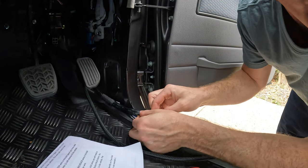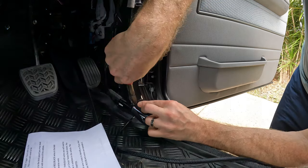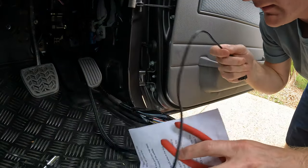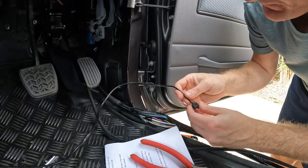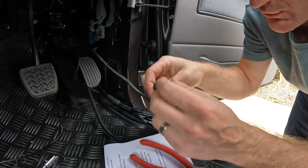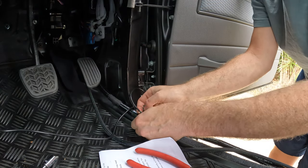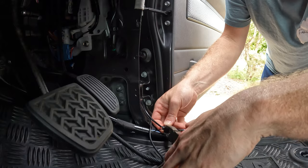You can get a current meter but I unfortunately don't have one - you just put it around the wire. I'm just cutting this so I can feed the wire back inside the cable and have it all look nice and neat. Pretty much how these splice connectors work: you just feed the donor wire through the center, clamp it over the top, and it splices in - no soldering required. So here's our wire - I'll go where I nicked the insulation and just squeeze that together with a pair of pliers.